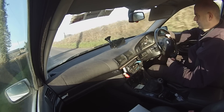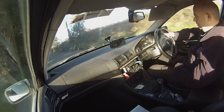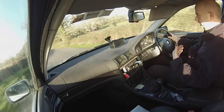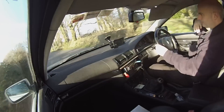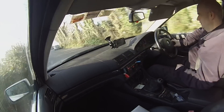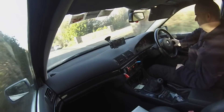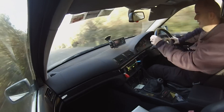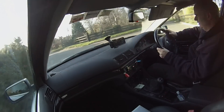I can accelerate a little bit here. Up a hill again, and there's my current limit pulling me back right when I don't need it. I have to nearly pump the throttle to get the current limit to come off and then reapply the power — just finding my way through the little holes and traps in the rev range, it's quite a challenge. Regen is extremely good though — 20 to 22 amps of regen there on the brake pedal.